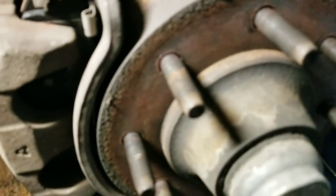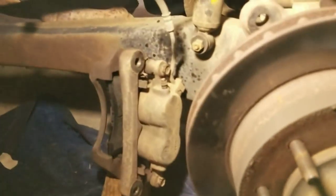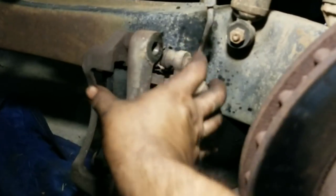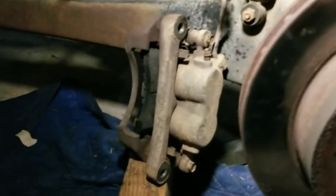I'm going to pull this bigger bolt out — I figured out that bigger bolt was 13/16ths. 13/16ths on the bolt that pulls the whole caliper off. Now that you've got your caliper off, your new pads are already in there, so you don't have to worry about that. They're spaced out where they need to be. Now you can take your bigger impact and tighten those up that hold the whole pad assembly together. You can tighten those up right now that it's out and turn it around — it makes it easier.